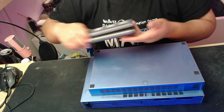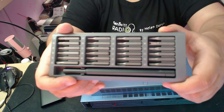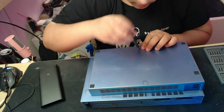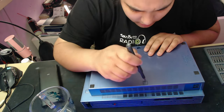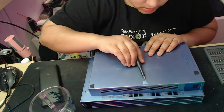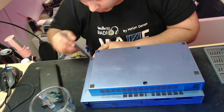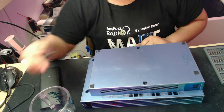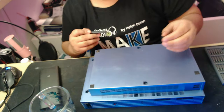We will be using the Xiaomi toolkit. I really love this screwdriver set. They have all the screws I need. Start by taking off the eight little covers for the screws on the back of the PS2. There are two on the lip, and then there are six right underneath. Four of them are rubber, and the other four should be plastic.